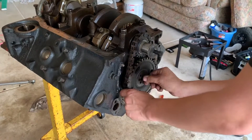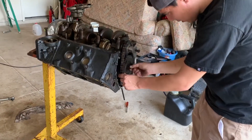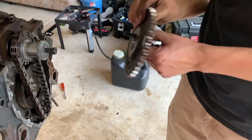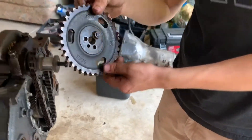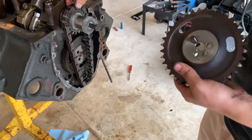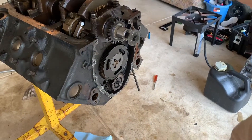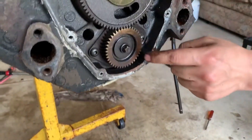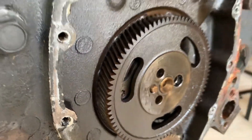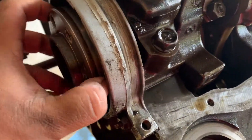Alright. Timing chain and the gear — about to come off. Oh, there we go. That's it. First gear out. Oh, this can come out too. That's a nice feature they have on there — the bolt can come out and it only lines up right back there. Very interesting. Can this come out? Yeah. A little gear. Let's check out what's going on in here. So I guess you align that there first with that dot. And then let's take off that oil pump and take off these bolts here to release this crank cover. The casing. Alright.